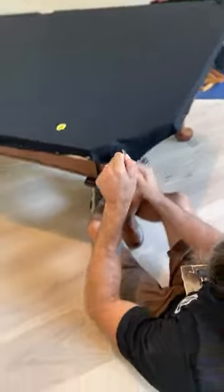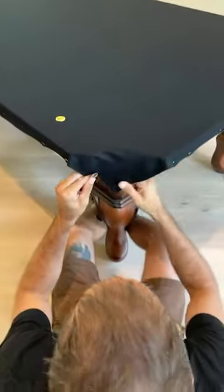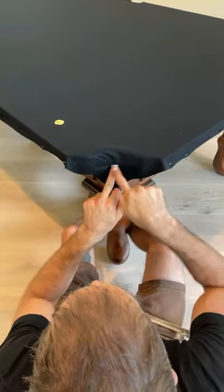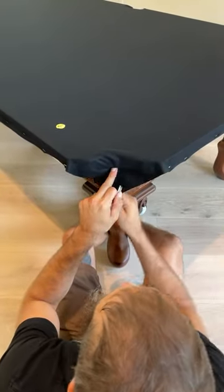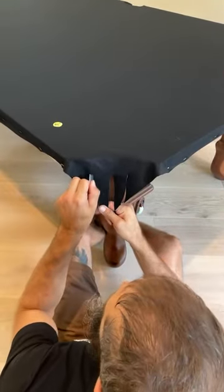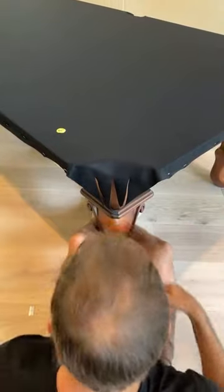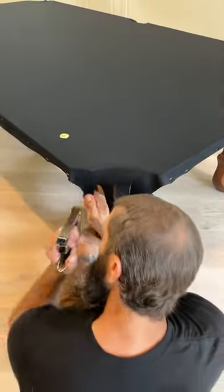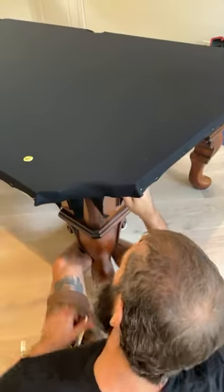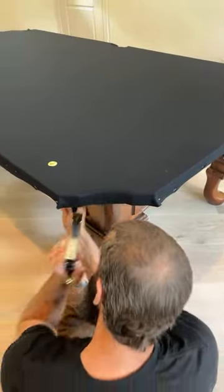And with the pockets, we're gonna go straight down the middle with the frame of the corner. Okay. So as long as you get it, and you don't have to cut any higher than the lip of the bottom of the liner, but you do want to cut 4 fingers on these, because what we're gonna do is pull this one down and tack it, and then we're gonna pull the outside one down and tack it, and then we'll pull the 2 middle and tack them down.